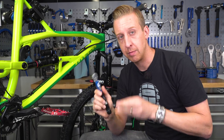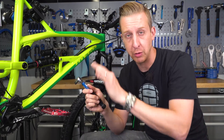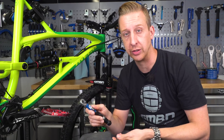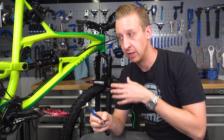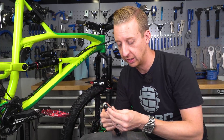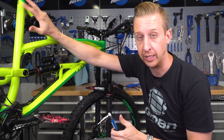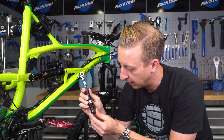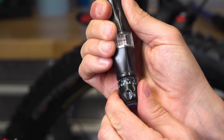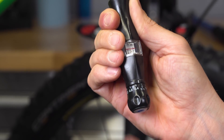This medium-sized torque wrench is much more usable for most mountain bikers — you can use it with regular socket sets and it's good for most things on your bike: chain ring bolts, handlebars, stems, seat collars. It's great for peace of mind: put your bike together with your regular Allen key set, then use the torque wrench to check all the bolts afterwards. Here I'm checking the seat collar, which says 2.8Nm on it, so I'll dial it in — the dial does it in 0.2 increments, so I take it down to three with one extra click.